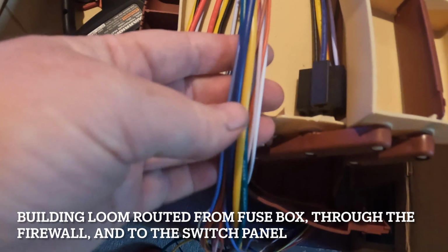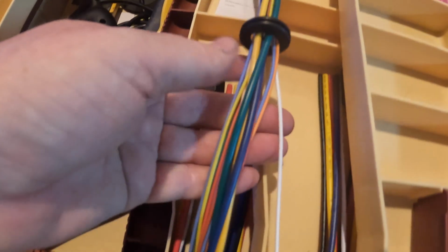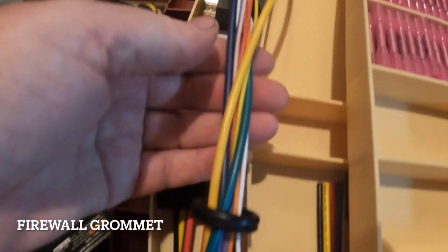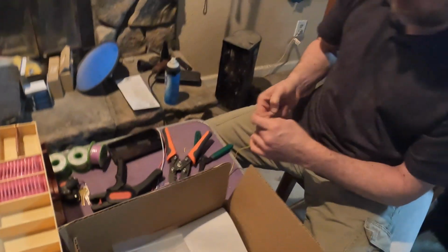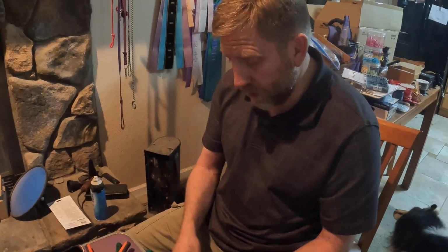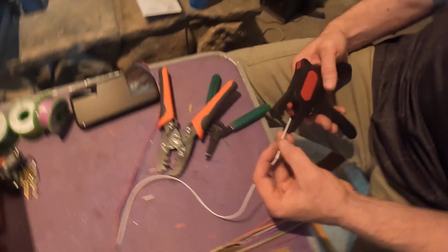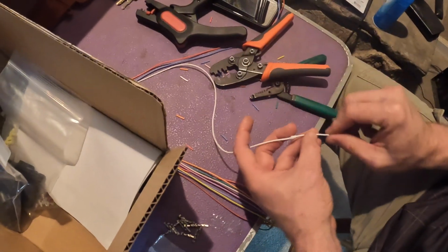11 wires for the triggers, 3 wires that go to the loads. In this case, inside the cockpit, we've got a load that is a stereo amplifier and 2 loads that are heated seats. And so heavy wires for those things that are going to carry significant current, and these light wires that only have a relay behind them.